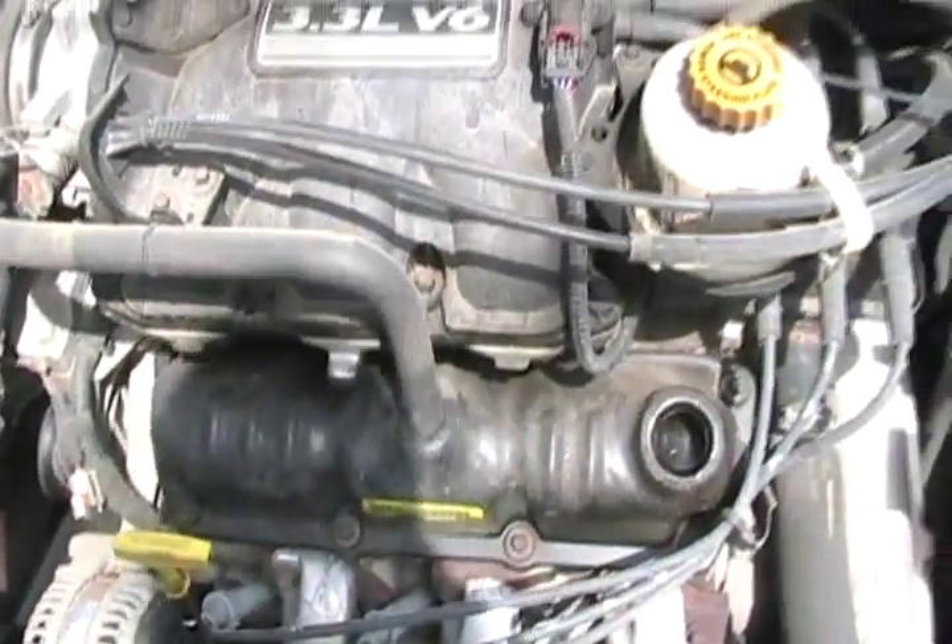The engine has to do something with the blow-by, or it blows out all your seals. So in the colder months of the year, the moisture goes to the top of the engine and condenses on the coolest parts, like the dipstick tube and the oil filler cap, and that mixes with the oil that's on there, making it coffee-colored or creamy-colored — and makes you think you have a bad head gasket, but you don't.